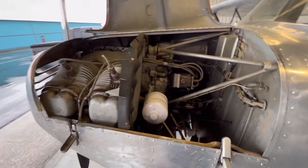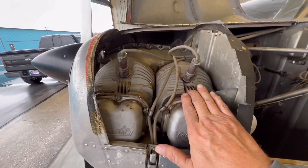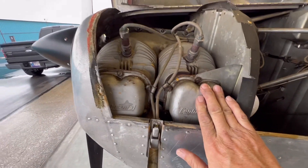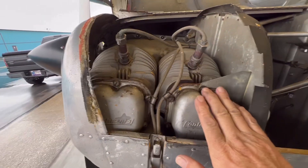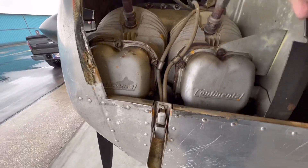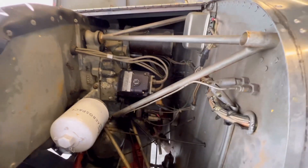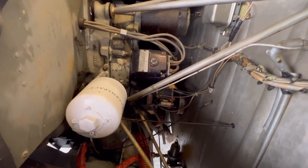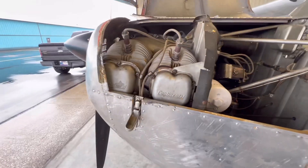For those who haven't seen an airplane engine before, these things are actually like a VW — they're opposed. There's no cooling system besides that hole and that big fin right there, with the big propeller blowing air through to cool the cylinders. These things actually have two spark plugs for each cylinder, and two magnetos separately. So it has a backup system where if one should fail, you still have another one you can run on.